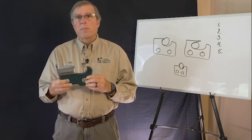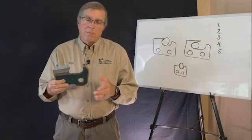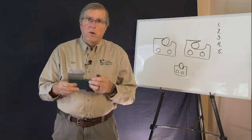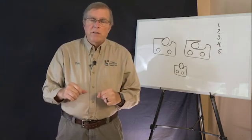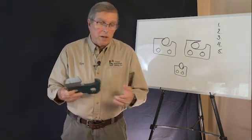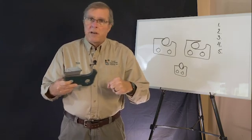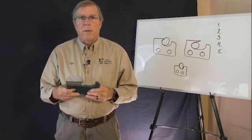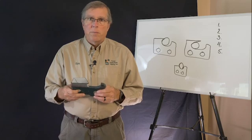When you start to cut a piece of wood, a log or limb, you should be cutting about 1 inch a second, maybe a little bit slower than that, but more or less you want to be moving into the wood. If you're on a piece of wood 10 or 12 inches round, you should cut through it in about 10 to 12 seconds, maybe 15. But it should move through it. It shouldn't be sitting there for a minute, minute and a half with you pulling back and forth and smoking chain to get through that piece of material. So you want to make sure that it's doing the work for you.